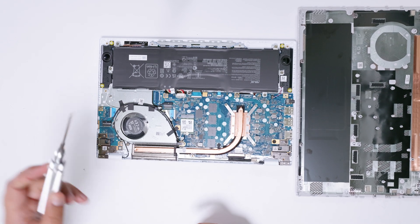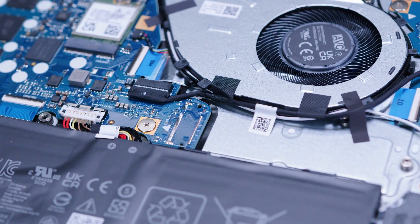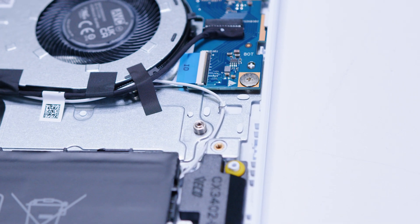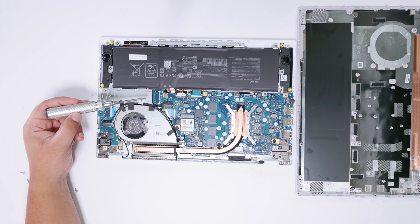Here's the most interesting thing about this laptop. If you look closely, you'll see there are provisions for an M.2 slot — it's not soldered to the motherboard, which is very odd. Asus thought it was clever to leave the M.2 mounting post in there. Why not just release one version without eMMC memory — because it's usually pretty slow and garbage — and just use a Gen 4 NVMe drive? Even a 128 gig one would have been adequate. Repairability is minimal since everything is soldered to the motherboard. The fact that the M.2 mounting post is there but the slot itself isn't on the board is so odd.